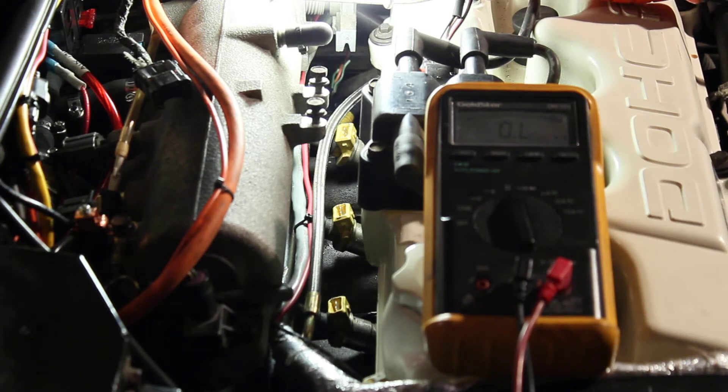This is my first video since I tried to start the car. It did run a little bit but it smelled a lot like gas and I couldn't keep it running, so something was definitely wrong. I realized shortly thereafter that when I had fuel pressure on the line, basically once the pump purged and first started pressurizing the line, I'd have 60 psi, and basically as soon as I gave power to the injector circuit it would drop right to zero.